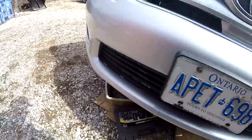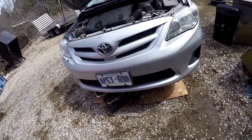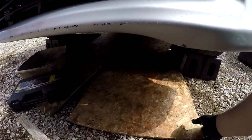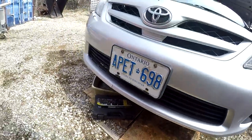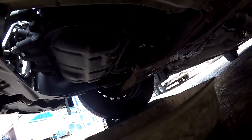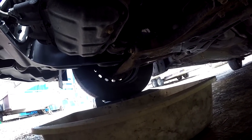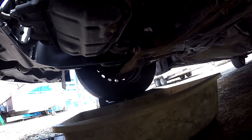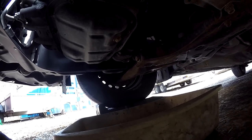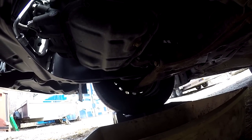I've got the filter with me because we're gonna do this all at once. I'll crawl under here first and then we'll get you under here too. There's where we're working — that's the filter way in behind, I hate that filter. I think the drain bolt is a 15 maybe — let's try the 15 on there.